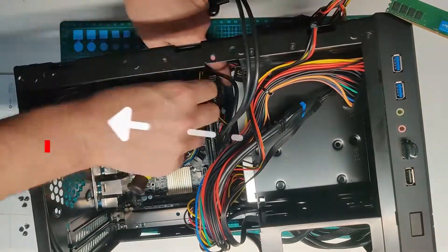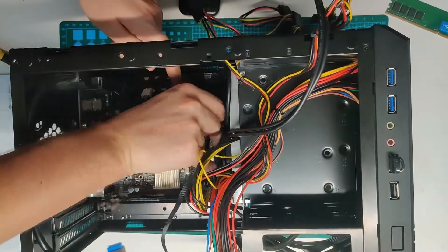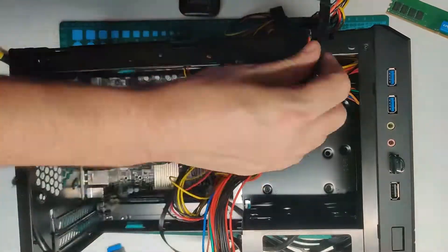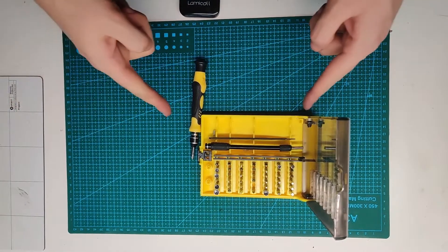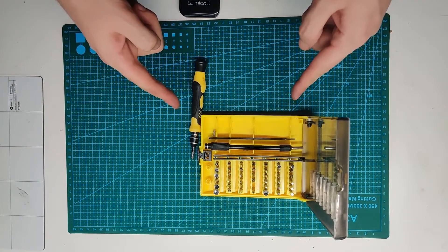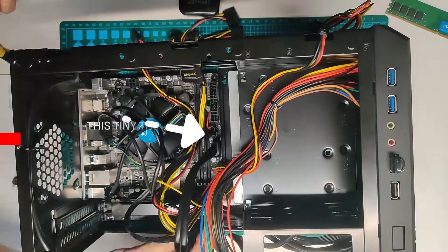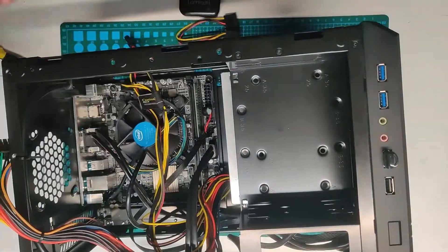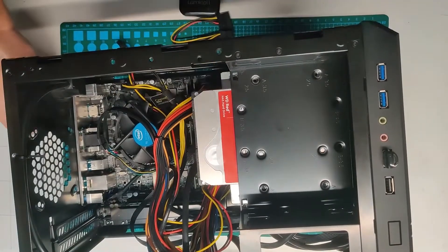There's also a 500-watt power supply. The trickiest part is the motherboard interface — it's hard to mount because of some really small parts, but otherwise it's just screws and cables. I'm using a multi-function screwdriver you can find for 15 euros — I'll put a link in the description. Another annoying part is the pins on the motherboard for the power button and the hard drive LED. More advanced motherboards have easier pin solutions, but this one is quite small and old.